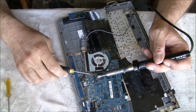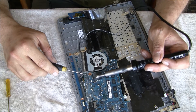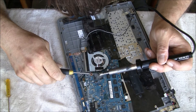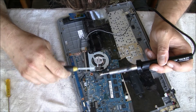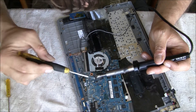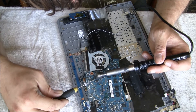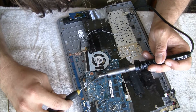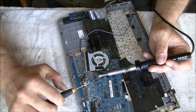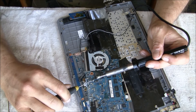The chip is located on the other side of the mainboard, so I had to disassemble half of the computer. You have to keep an eye on the different screws — I made two little piles: one for all the screws for the plastic around the computer, and a second for the screws which hold the computer components inside. The screws inside are all small, so when reassembling, use the small screws for everything inside and the bigger screws just for the hard drive area.